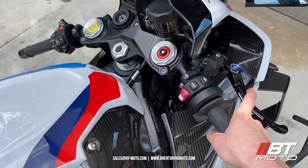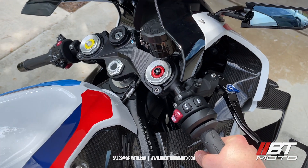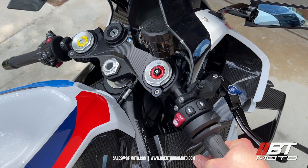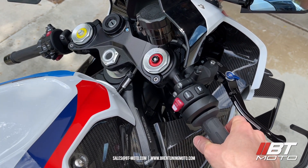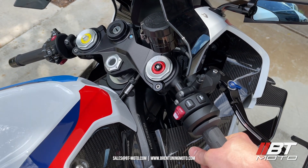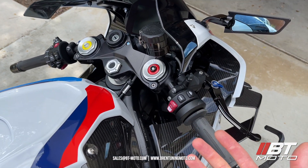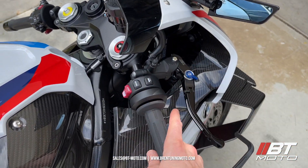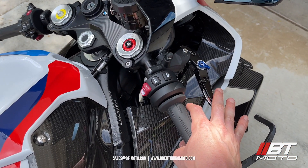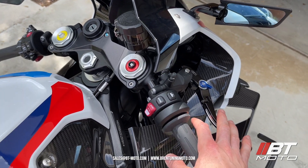You can vary loads — if you want to do 50%, 75%, then get to 100%, you can do it that way. I just do 100% on, let it off, 100% on, let it off, like that. It's not bad to go 50% or 25% either — there's really no universal method agreed upon. The whole point is varying RPMs and varying loads; that is important. The RPM limiter on this bike is about 9,000 stock — you cannot wrap it all the way up to 15,000.